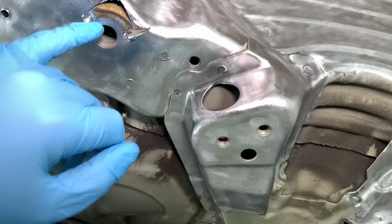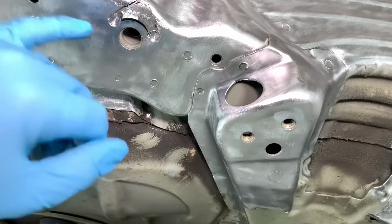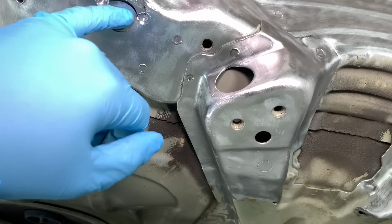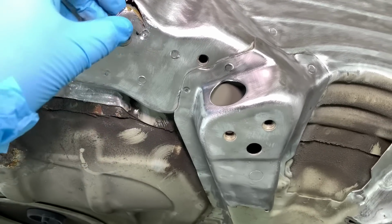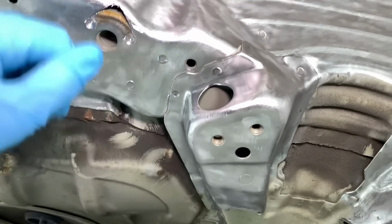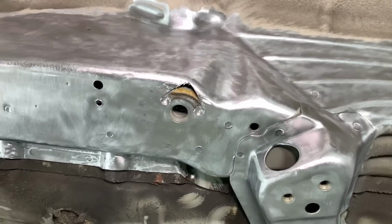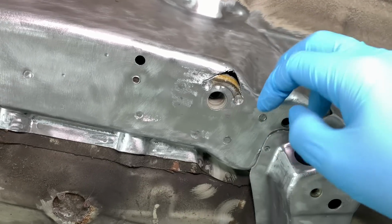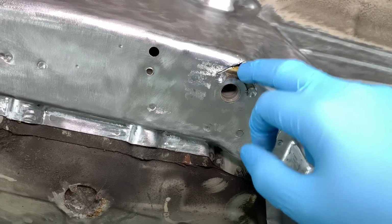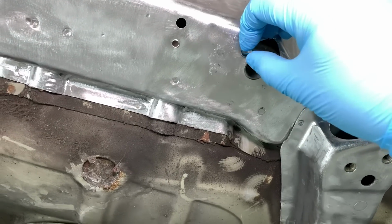And we don't do anything on this line, and what we try to then show and prove on our videos is that that circle there, that semicircular piece, which we haven't introduced or cut, proves that that's the crack, that's where it is. So that's why we leave those on until the video comes along and then we show that that was the crack. That's what we need to do. There's no point just welding on top of it. We find it's always best to take a piece out because you can then actually get to the threaded platform inside, which is 2mm thick, apply that plug weld, and that will fill up all that.